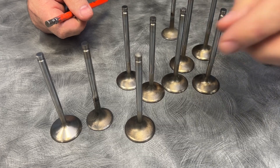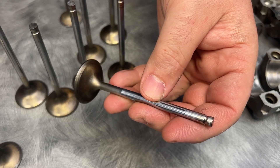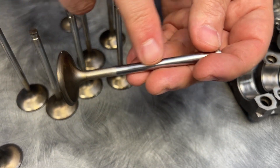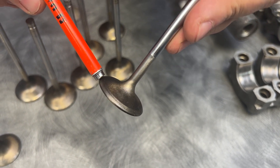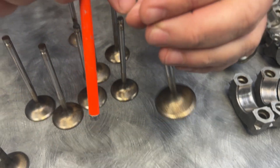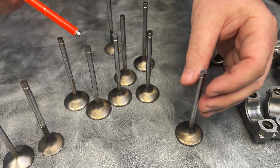Looking at the valves — I just don't see much. It doesn't have a lot of run time on it, but these valves have actually been in the car for five years. We have no wear here. The 45-degree seat looks really, really good. There's a lot of margin left. I don't see any signs of float, so there's nothing on the top of the valve and nothing on the 45 that's abnormal. I don't see any heat going up the valve.